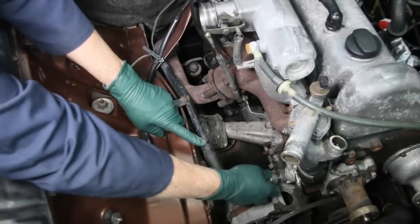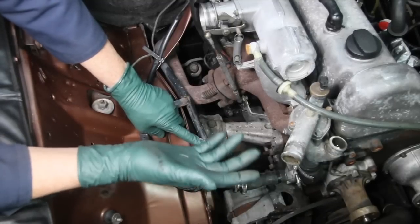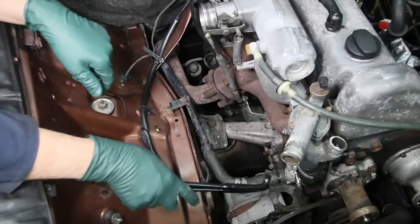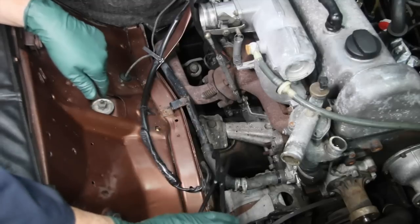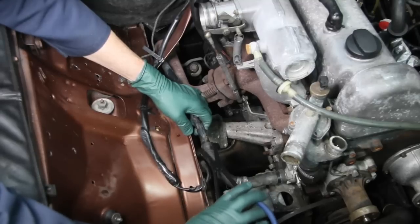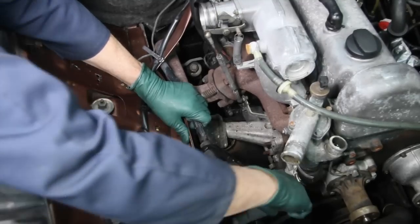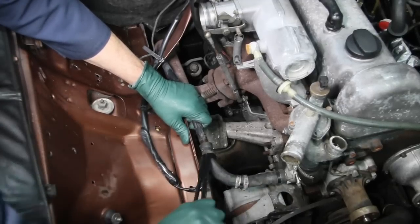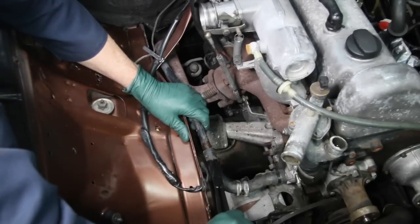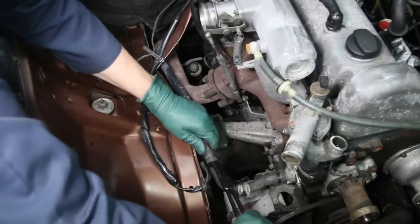Have any of you ever tried to get these hoses off after they've been on for 5, 10, 20, 30 years? Enter the larger clamping tool that we make here in the shop. Watch how easy it is to get these hoses loose from the pipes — grab it right on the pipe, squeeze just enough, then twist it and eventually you can break it loose, then back it up away from the pipe. I'm going to lose some coolant here; I've got a drip pan on the floor, and I can use this tool to pull it off as well.